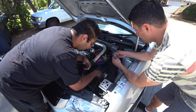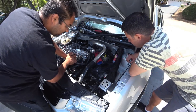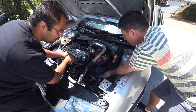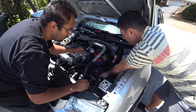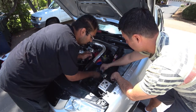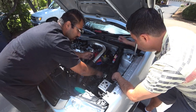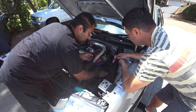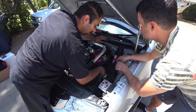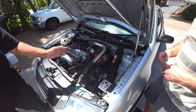So we're going to try to do... Once you pull it out, I'll just try to drop it in. No. Hold on. Almost there. Let's come towards me. We'll put this one in first, okay. Right there. So a little bit in there. And you'll see. And then we're going to grab a flathead screwdriver, cram it in here, and then pry this way. And that'll give us the tension that we need to line up the motor mount correctly.